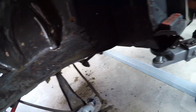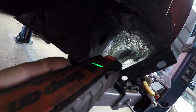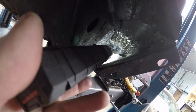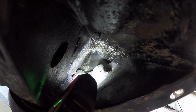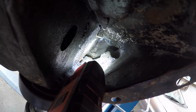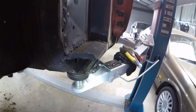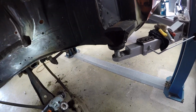Now, the other thing is, I've just noticed here, I was looking down the turret. I don't know if you can see that, but right down the end there, we've got rust occurring again. It's only surface. So that's looking down the sill that I replaced some years ago. So what I'm going to do is something that we have in aeroplanes, and that is along the bottom of the sill, I'll put a couple of holes, and effectively they'll be drain holes.